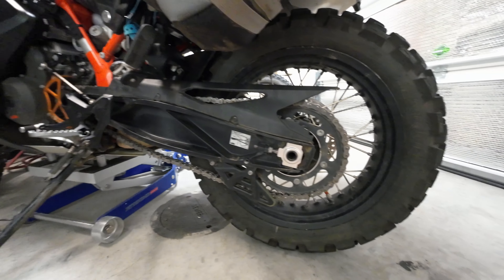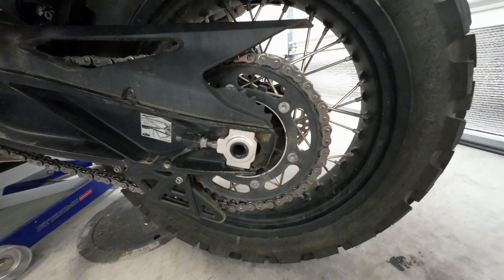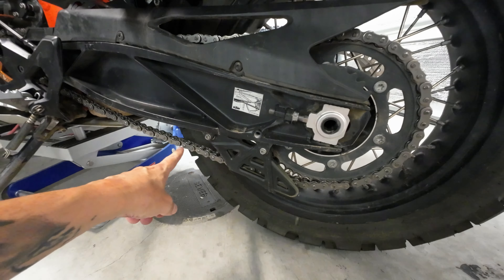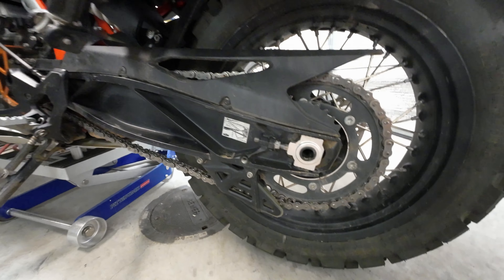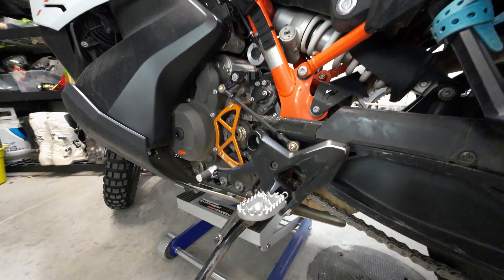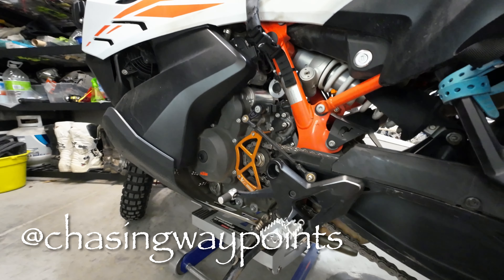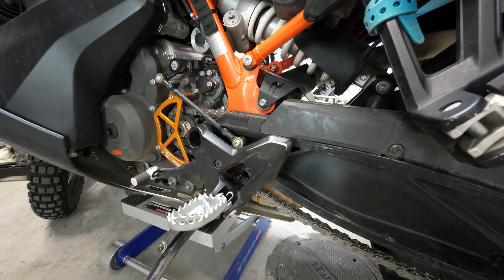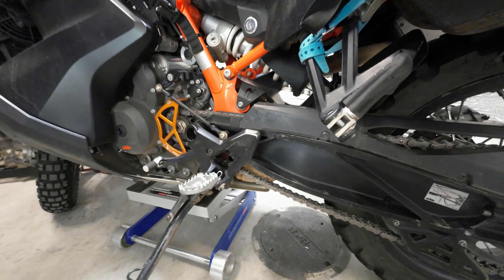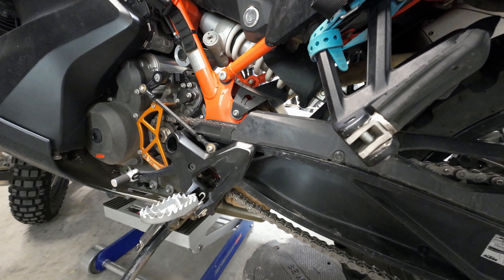On the way home it was stretching pretty bad. As far as chain maintenance goes, I don't do anything really — I don't put oil on it, I don't clean it. I'm pretty much in a dry, dusty environment and putting oil on it just collects more dirt. The stock chain I got 12,000 miles out of. Now if you're in the water and stuff, just a little bit of WD-40 when you wash it so it's not rusting up — but that's it as far as maintenance.